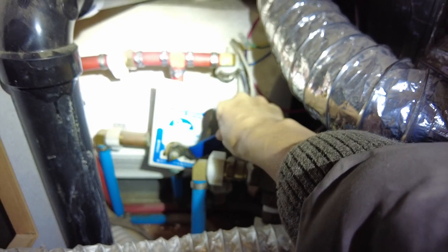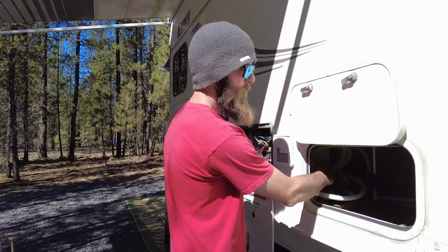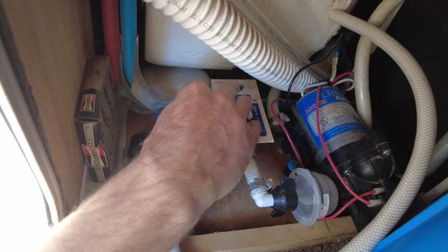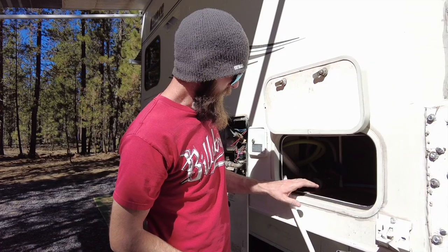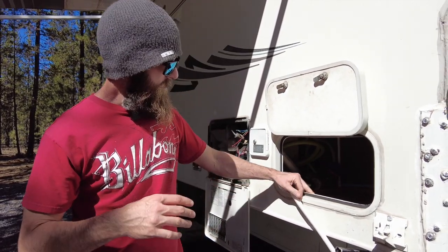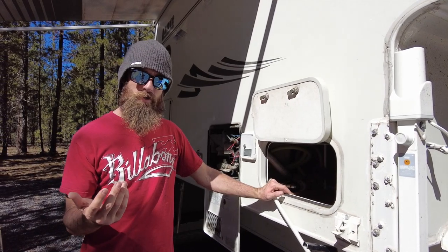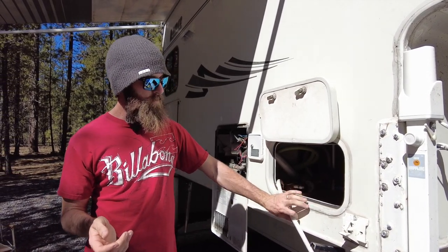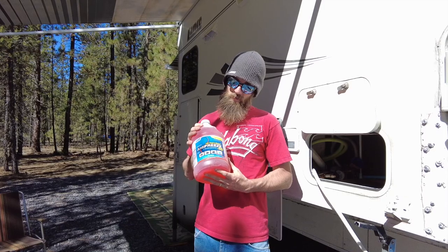What this does is bypass your water heater for the next step. Now that your water heater is bypassed, switch your pump to winterize. There's a little valve right next to your pump, and you'll find a little hose with nothing on the end of it. This tells your water pump to pull liquid out of this hose instead of from your water tank, which is what we want.